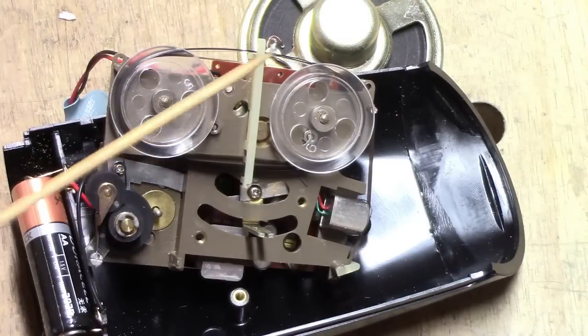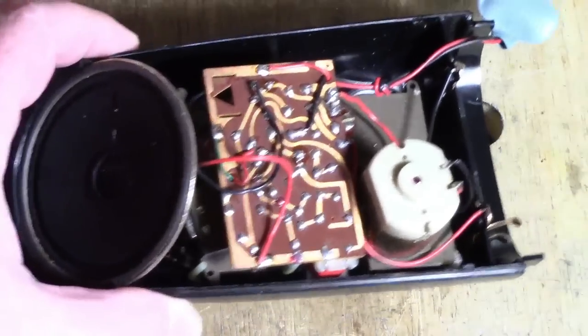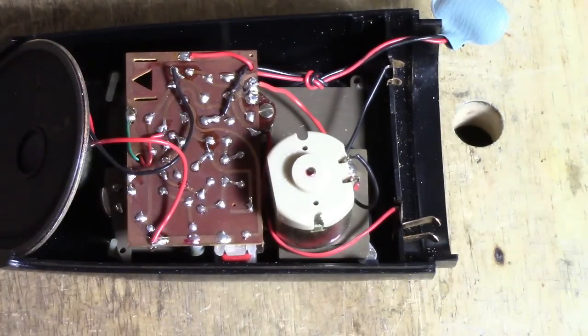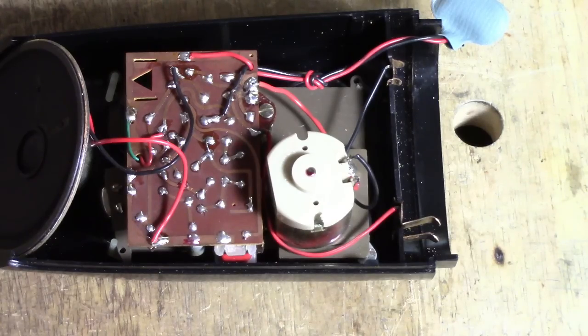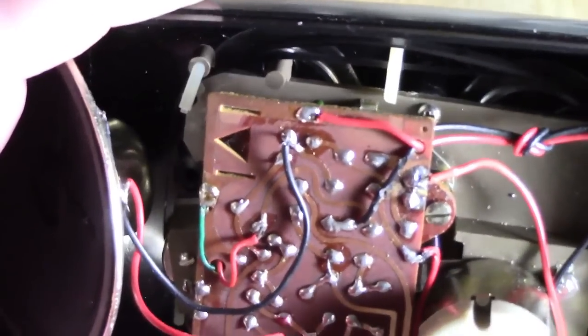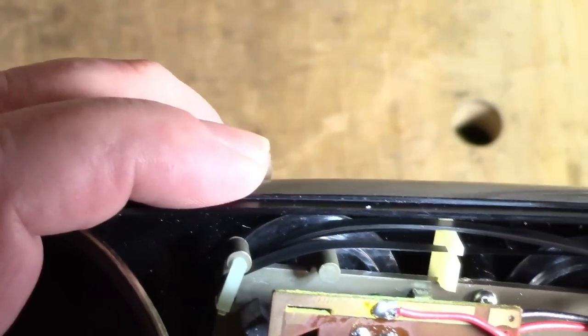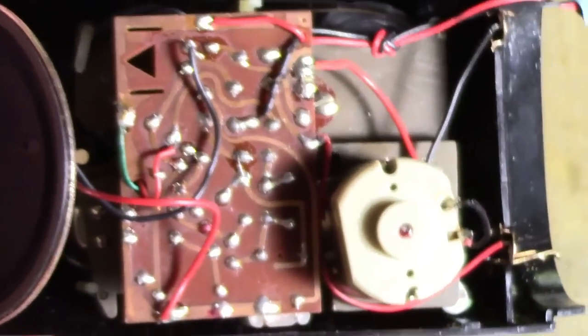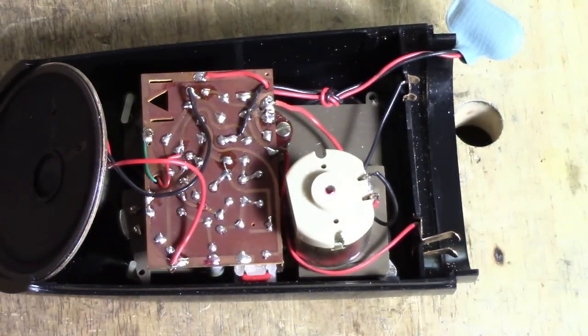The amplifier is located underneath this, and we'll look at it when I turn this over and screw it back down into the case. I have the machine back in its case. Here's the speaker, held at an angle, and this is the amplifier board. Here is the motor — we saw the other side of it. There actually is a magnet in here to do the erasure. You can kind of see from underneath the way the tape works through multiple passes — that's how it's guided. Very complicated system. I'm glad I didn't have to do any work on the capacitors on the board, because getting that amplifier board out would be very difficult. The wiring on this machine is quite old and quite brittle.